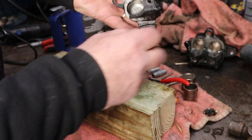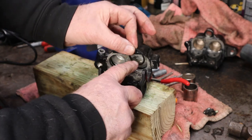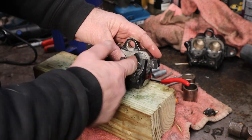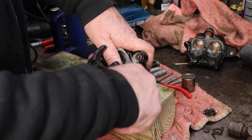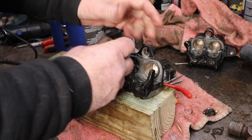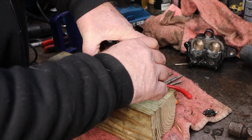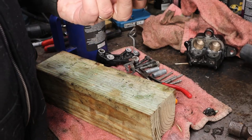See this one's not sitting in right - he's kind of up on the edge. There he goes - make sure he's down. If you don't, you're going to clip it with that piston and you're going to cut it if you try to push it in real hard. Piston on my thumb, started in there, get it past both seals - goes right in. Same thing on this one - I want to wiggle and watch for it to go past that first seal, then the second one, and in they are.